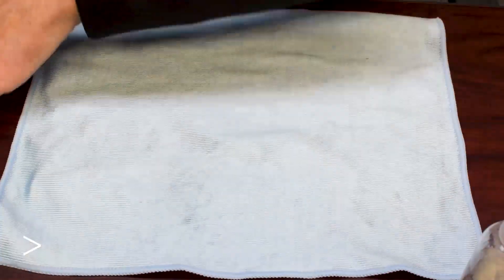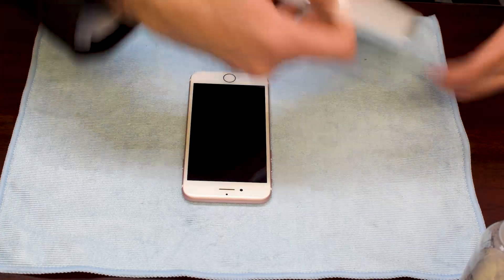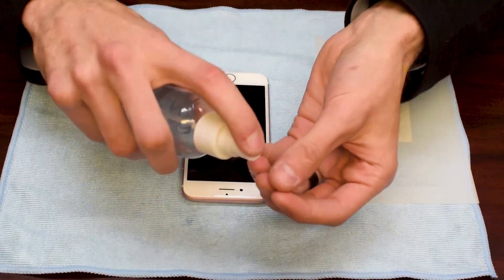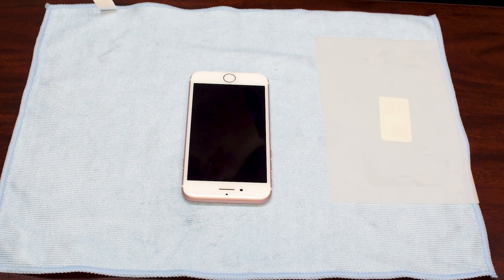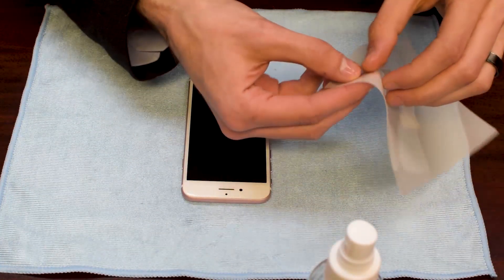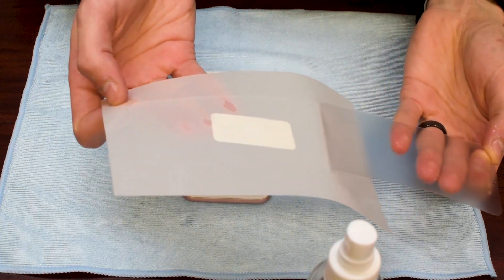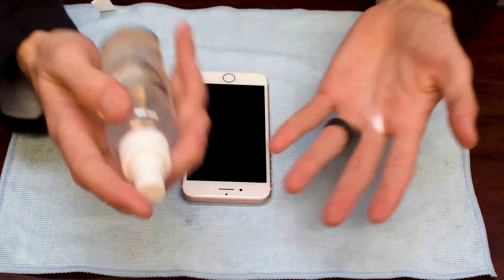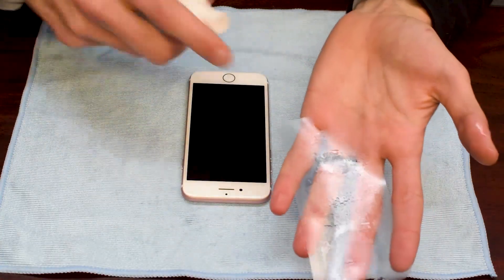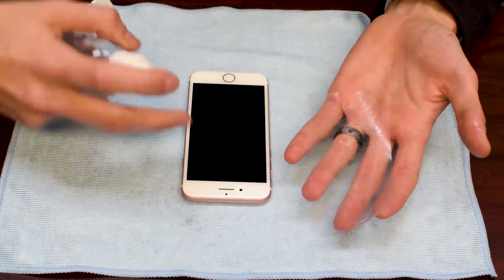Go ahead and wipe this off. Once it gets peeled up just a little bit, I'm going to put a little bit of spray on both of my fingertips so that way it doesn't stick to the screen protector. And then just slowly pull it just in case there's any small snag. I'll put at least three sprays — that's good because it's a small phone. If you have a bigger phone, you can put a couple extra, but you just want a good coat. And then you're going to put some on the actual phone itself.